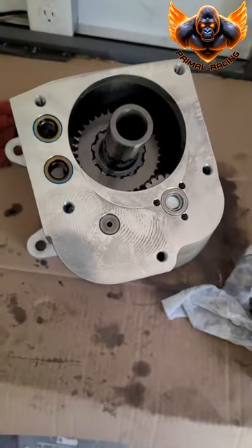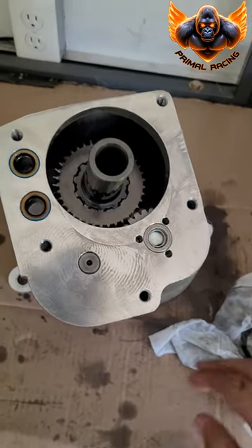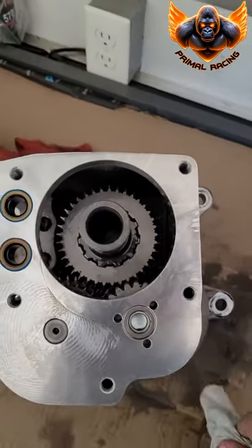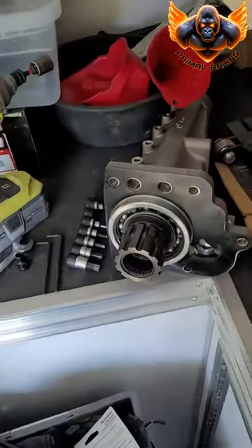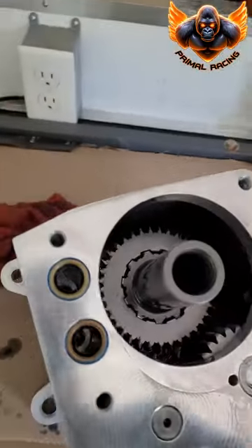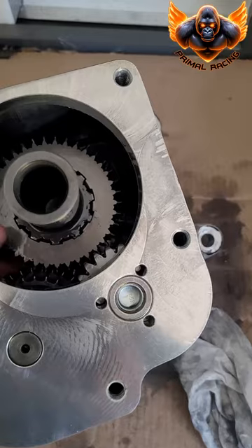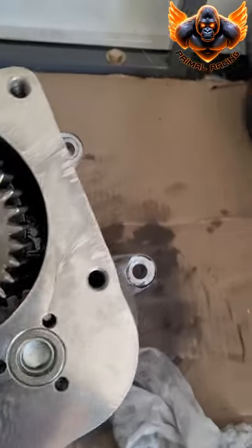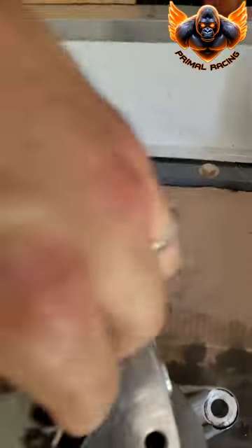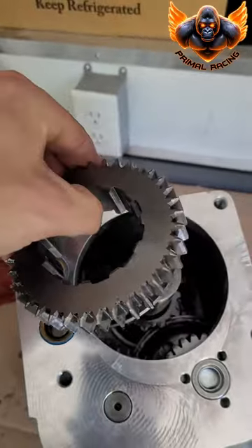I had a little bit of cleanup because some excess transmission fluid didn't drain out — it's still trapped in there, so when you remove the tail housing a lot of it leaks out; that's why I'm using cardboard under here. The next step is to remove the high-low slider gear — it comes out really easy. The shift fork groove goes down, so remember that when we reinstall it later.